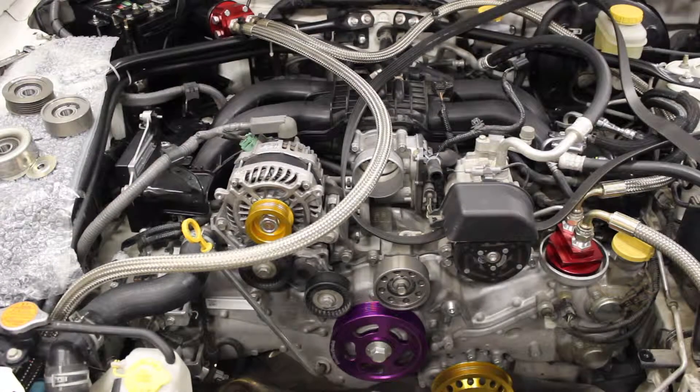I have only about 20,000 miles and my OEM pulley bearings are already showing signs of play. Bearings are wear and tear items, and upgrading to the Nonstop Tuning pulleys with serviceable bearings and keeping an eye on them after every few drift or track days should help in this department.